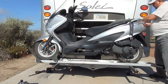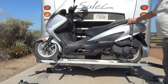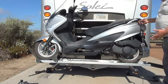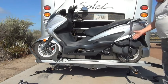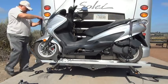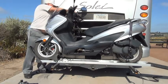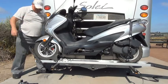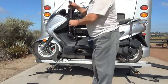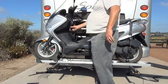And you also need to have a bike where you've got something in back that these straps can hook onto, like this. And make sure that they're resting down to the lowest point. If you strap it with it like this, and then you tighten it up, lock it in place, it can slip down here, and then you don't have a tight grip. Another advantage of a style like this is that it's easier to put on the front ones, where you can always leave it hooked and just strap it on like that.